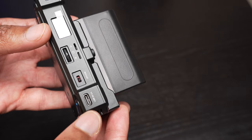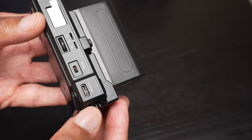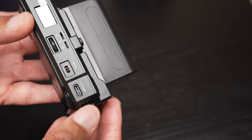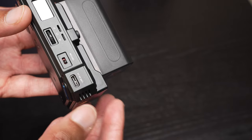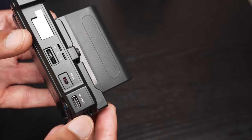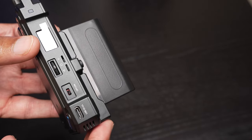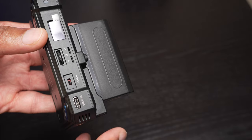The one thing that is different about this USB-C connector is that it can be connected to a computer, because this transmitter set actually supports something called UVC — USB Video Capture. Basically, what that means is if you plug this into a computer, it will detect it as a webcam-type device. So you could actually do a Zoom meeting, FaceTime, Facebook Live, or any of those services — it will show up as a webcam. Now this leads me to one of the few critiques I have about this unit, which is really about the manual. On the Amazon store they explicitly state the USB webcam UVC capability, but if you look at the user manual, it makes no mention of this. It would have been nice to see that in the manual, but it does work very well.